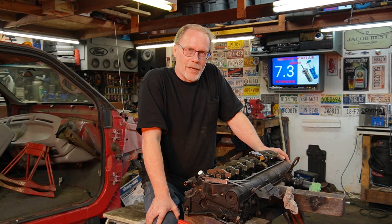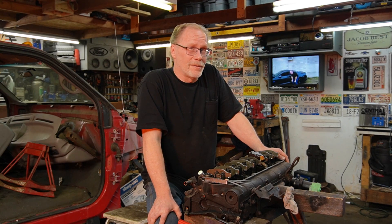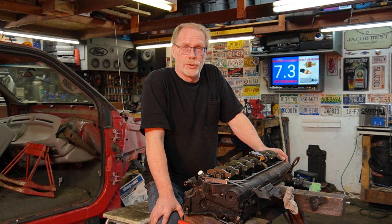The promise is that you will shim these up in accordance with the directions and your truck will run all that much better. Well, there's a lot of holes in this to begin with. First off, if you are having run-ability issues, a lot of times if it comes down to the injectors — do you know it's the injectors? Is it the fuel? Is it old oil? Is it a bad sensor? So many other things go into the run-ability of any engine, especially a 7.3 with the HEUI system — a low high-pressure oil pump starting to fade out on you can cause issues.